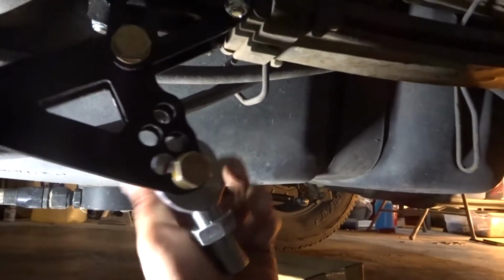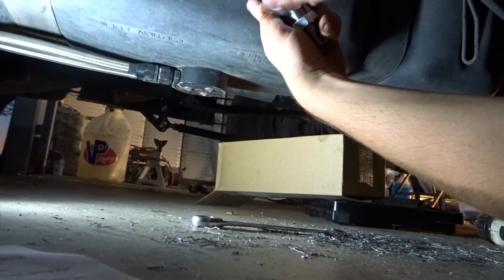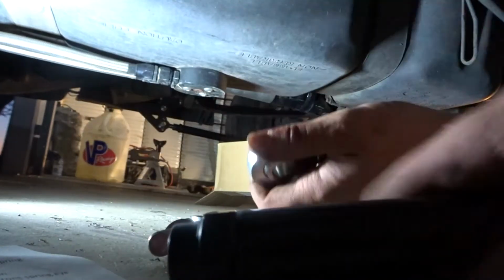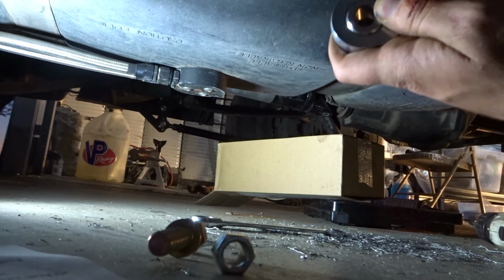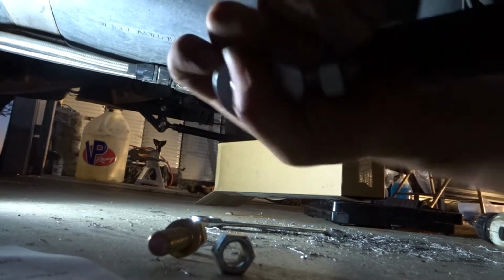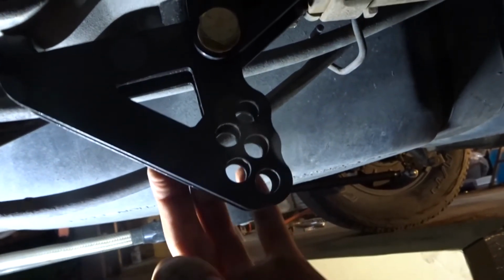As you can see, it's right in the center, how it's supposed to be. Next, we're gonna remove this and screw it into the bar. Side with the wrench that you can fit a wrench on that goes forward, so you could adjust it easily. So I'm just gonna start screwing it in here. Just like that. I'm not gonna go too far in. And then it says in the directions to put it in the center hole to get a baseline, and then you could adjust from there.